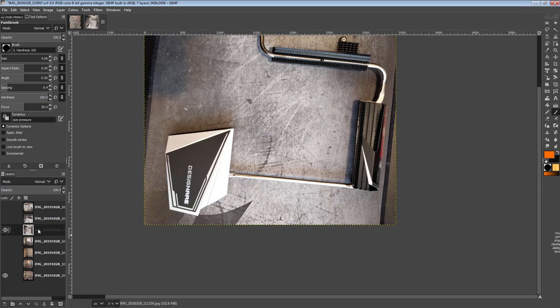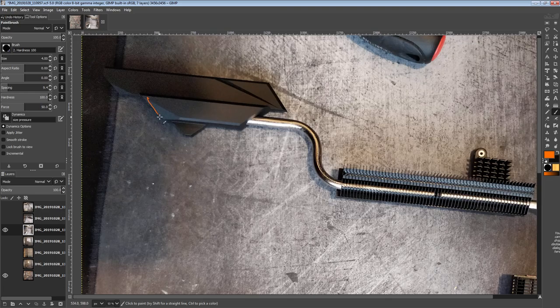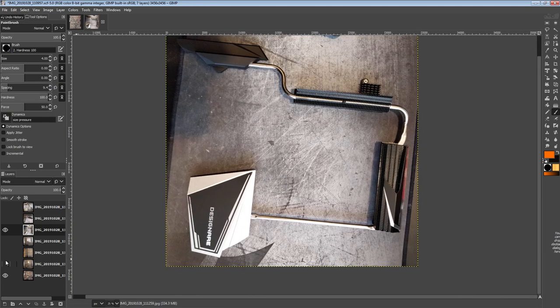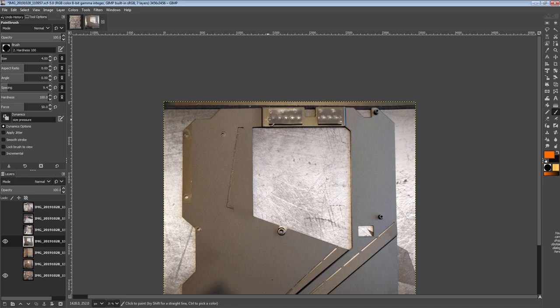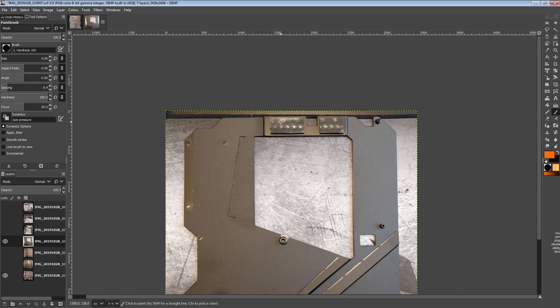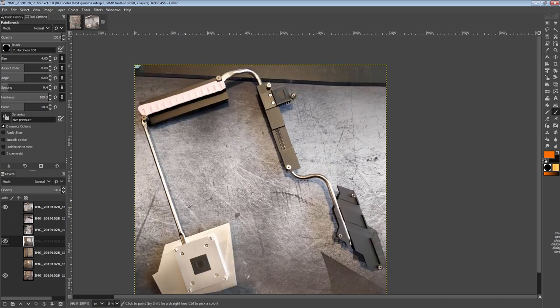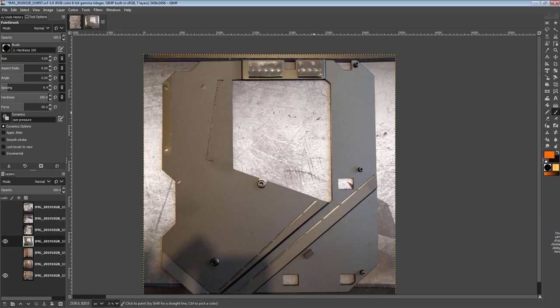Here's the whole heatsink assembly — you can see the chipset part, and the entire fin stack for the board. Then we have this backplate, which acts as additional heat sinking for the VRM. The backplate also adds rigidity to the board so it doesn't flex during installation, and it protects against SMD components on the back of the board getting knocked off if you run it over a standoff while installing. It's definitely a nice addition to have on a high-end board because it makes the board more robust in general and acts as a bit of extra cooling.